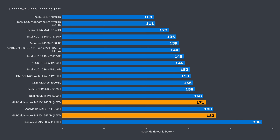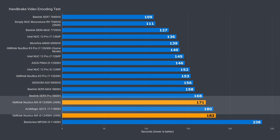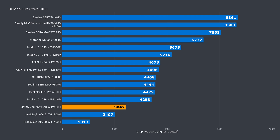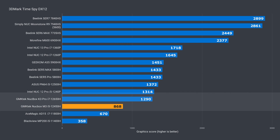But it's 13% behind when the i7 has its power limit increased. That changes with video encoding — the M3 gets beaten easily by the i7 in either power mode, though it's 5% ahead of the 11th gen i7 at 45 watts. The 3DMark graphics score is far ahead of 11th gen Intel units, but 34% behind the i7 in DX11 and 33% in DX12, owing to 48 versus 64 EUs on the chip — no surprises there.